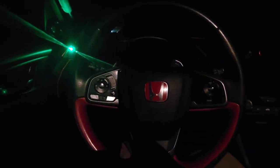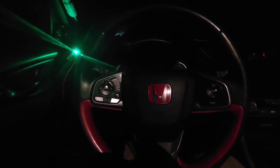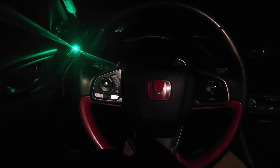This was kind of tough to figure out because I have to have the underglow powered by two different circuits. One that is only on when the accessory is on, wired to the switch. But then the other is powered only when the dome light is on. The problem I ran into is you can't tap directly into the dome light on many newer vehicles because a lot of lighting is controlled by a pulse width modulation circuit.